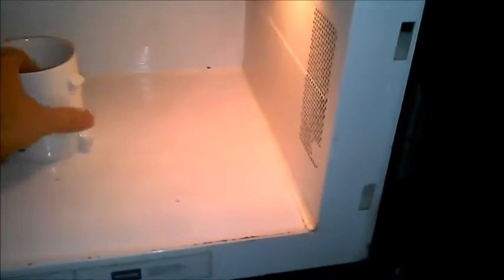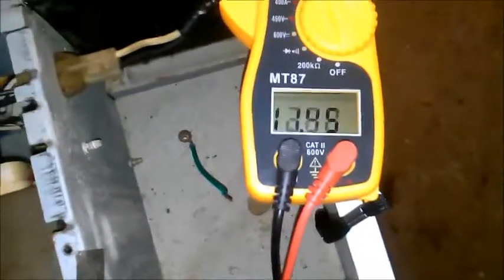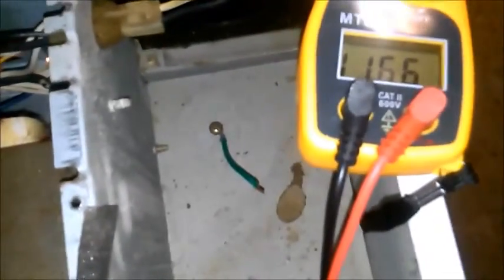I brought my heavy duty cord. Let's turn it off — oh, it is getting hot! This thing works. It's a shame the front is screwed to shit, but it works. I'm going to put the clamp on it. See how good this little cheap Chinese meter does — 20 amps. Magnetron is definitely running; that's pulling about 12 amps.